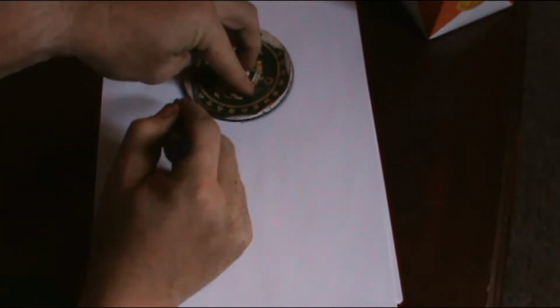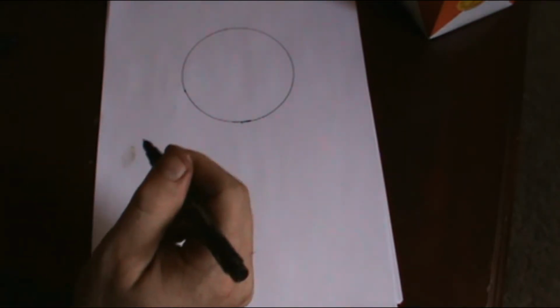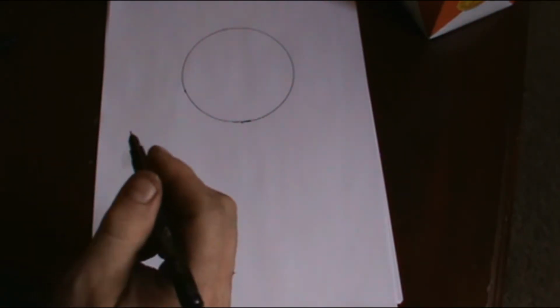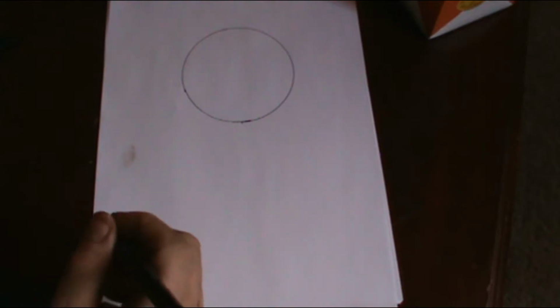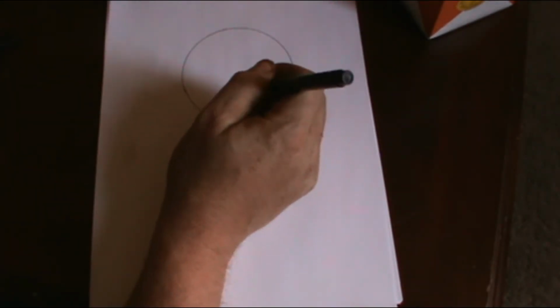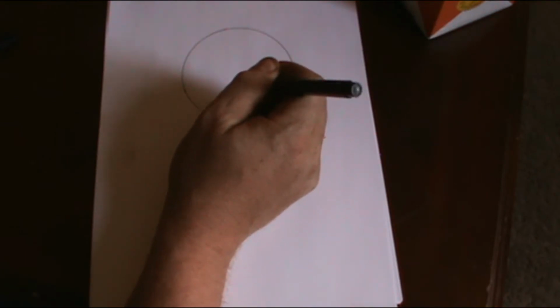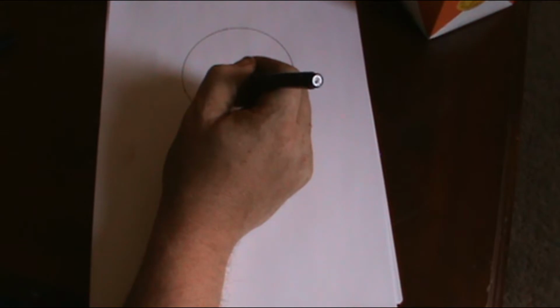What you're going to do is first have to understand how they set up the measurement for a ring and pinion, or for the pinion anyway. On the end of your pinion gear, there's going to be a number stamped. On mine, I think it was 2 inches, 825 thousandths. I do believe that was the number stamped on it.